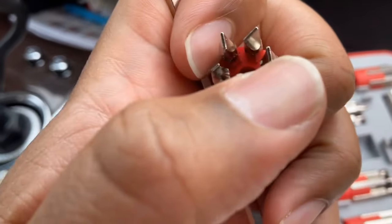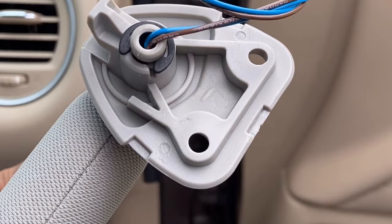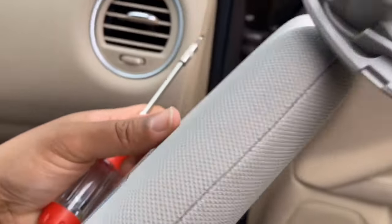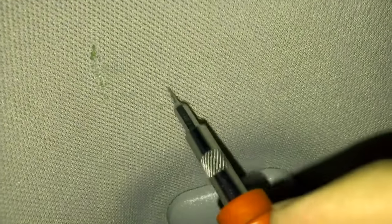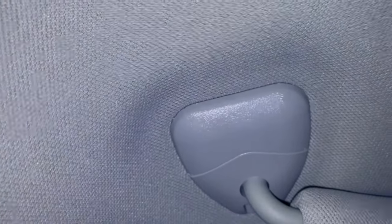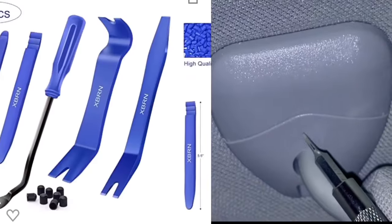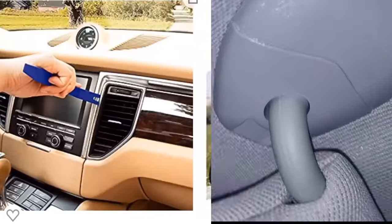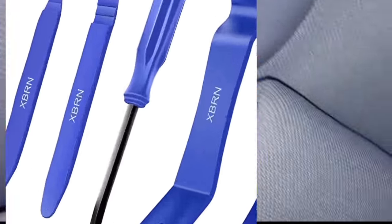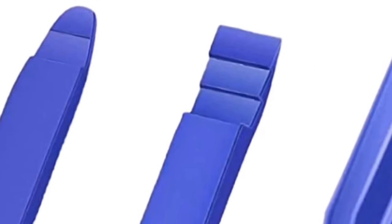I used a smaller screwdriver to split the edge and then a second screwdriver to pop it out. There are three notches with a clip that goes in there, so you stick the screwdriver on the side and it'll pop out. But if it's not coming out, be very careful — you could scratch the upholstery as it snaps off. If you're having a hard time, I'd recommend getting that trim kit, which I ordered myself — I have the link in the description. This is what mechanics use to pop things like this out.